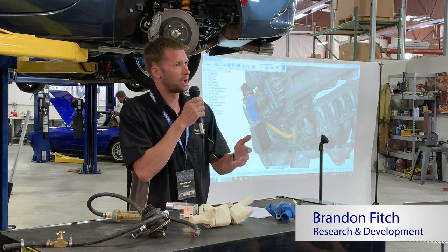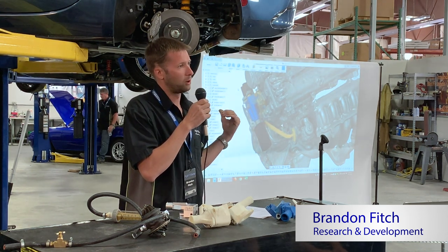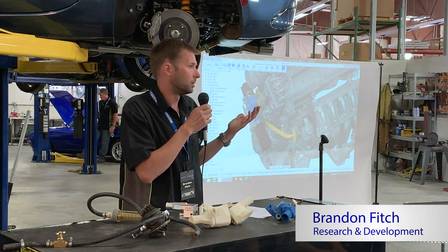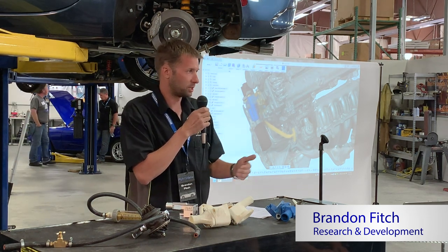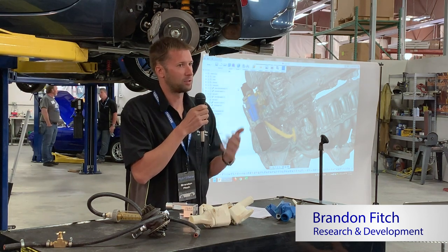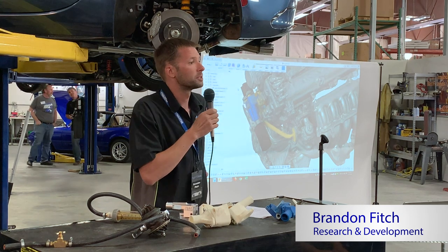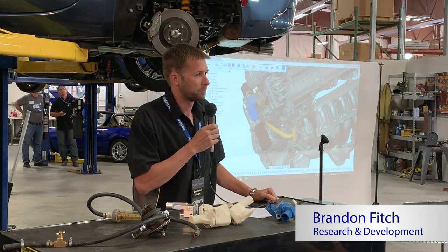So they said, well, that's okay. We'll just have the heater core come out there and we'll bring the water out of the front of the engine, which is okay in an understressed engine. But once you start pushing it farther and harder and you're generating more heat, you have to shed that heat, it is not great. It's a problem. Yes. I heard that the Mazdaspeed head gasket changed that situation. Is that true?